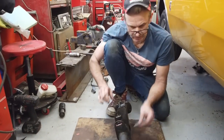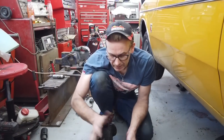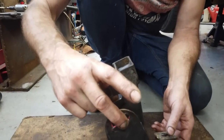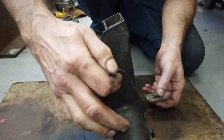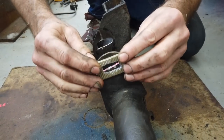But, and here it is, back to the serrated plates, everybody. This is a later axle which is fixed. There's these saddle clamps here which go on your lower arms. You'll notice if you know a Cortina, shock absorber bolts there. They, on later cars, just have a circular hole. We've had to enlarge this hole here, and we're making locking plates.